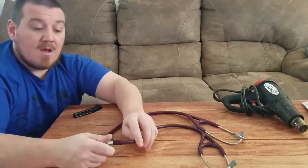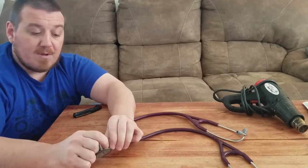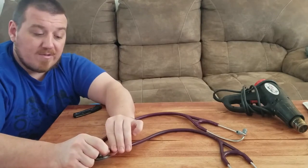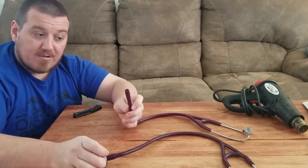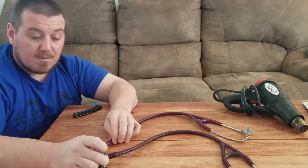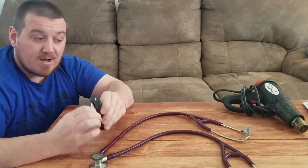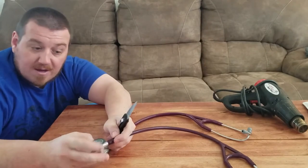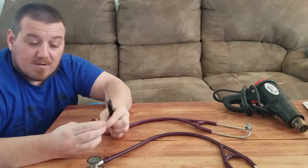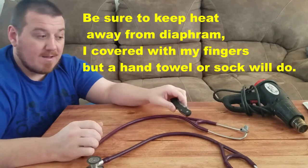The only thing you do have to do — since this is on there so good with such a large diameter — is use a heat gun. What I'm going to do is get the tip of this really nice and hot, pop this old one off, and then hopefully it'll still be hot enough to get the new one on there nice and smooth. One thing you should definitely avoid: do not use a knife. You don't want to try to cut the old one off because if you gouge this aluminum inside on the diaphragm piece, it's going to scratch and mark up the tubing and maybe even cut it. So here's the time-lapse — I had to take it all off.